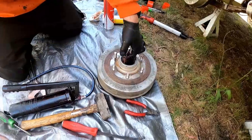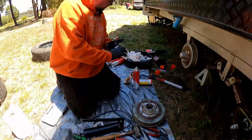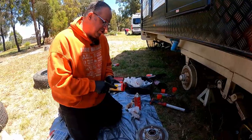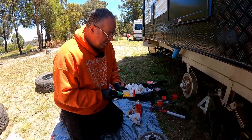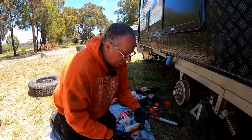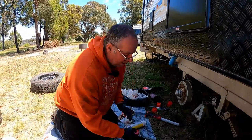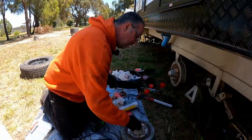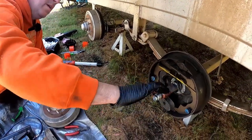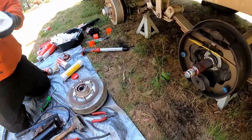and the next thing is this hole underneath, we need to fill the recess with some grease. So I'm just going to wipe my hands. And to be honest, you can do it with a grease gun. But I've already changed the cartridge now, so I shall use this one and just work out a big finger full of grease. In it goes, bearing back on top. A little bit on the shaft. Resist the temptation to wipe your nose.